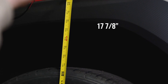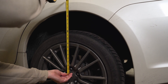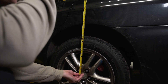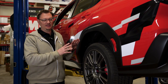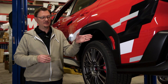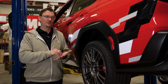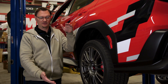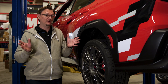Measuring, it's now at about seventeen and seven-eighths, and that is seventeen and a half. What we ended up finding in terms of droop travel was this is actually about in the same ballpark as the other two cars. Three inches of droop travel seems to be about the norm across all of these different models. This car has just under three inches, the GR WRX had almost exactly three inches, and the GD WRX had just about three and three-quarters inches — but Morgan's car has three-quarter-inch drop springs on it, which accounts for that extra droop travel.